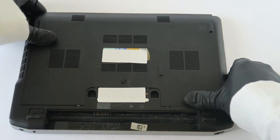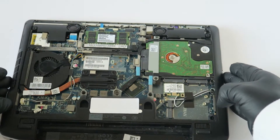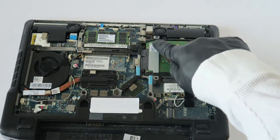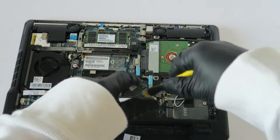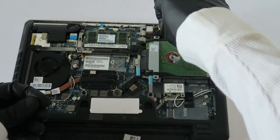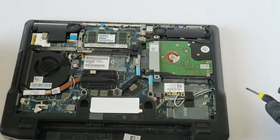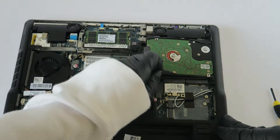This actually slides — this comes out. And it's got a plate right here where it holds the hard drive, 2.5 inch, one screw at the bottom and one at the top. So I'm going to go ahead and start from the bottom. Just right here with a little tab, you lift this up like this and it comes out.